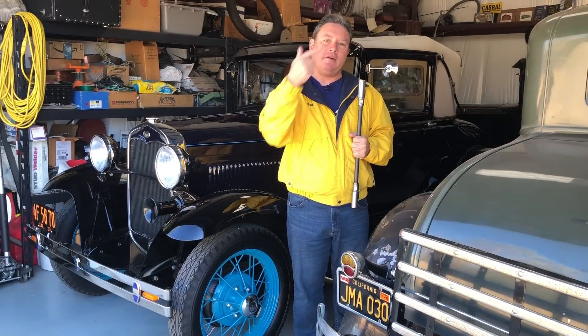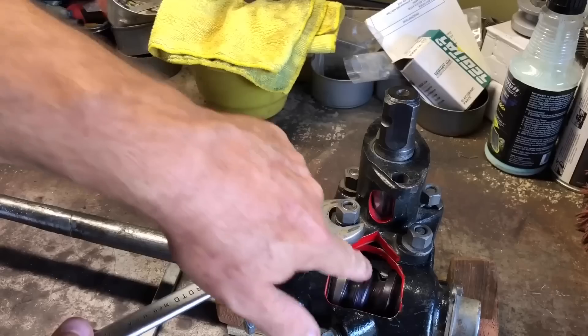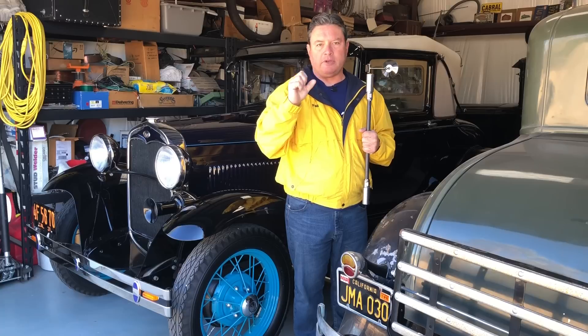Why is that? In a previous video, I'll link to it right here, where I was showing how to adjust a Ford Model A two-tooth steering box. You'll notice that in that video, in the steering box, in the middle of the steering travel — not at one end, not at the other end, but right in the middle — is a nice tight spot where the gears mesh really close, where there shouldn't be any play at all in the steering box. So the trick is, you want the steering box to be on that exact center point when the car is going straight. That's what keeps your car from wandering all over the place.